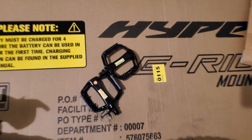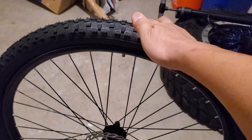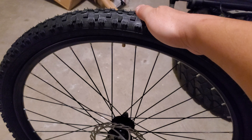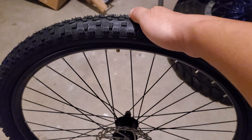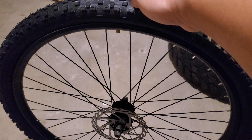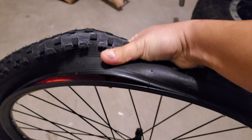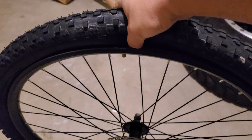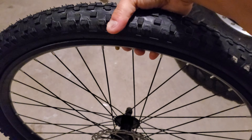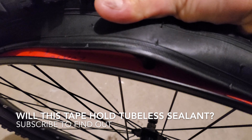I am really happy to see that the pedals are made of alloy, and they're pretty nice. They have the cheesy reflectors on them, but they're usable. One of the big questions I had about this build is what about these wheels? The slightly more expensive Schwinn Electric Boundary, which is also sold by Walmart, advertises itself as being more mountain bike serious because it has double-walled wheels. Are these double walled? Well, it turns out upon inspection, not only are they double walled — I can tell by just feeling the width between the inside and outside of the wheel — it also looks to be taped with a rim tape. So that's nice.